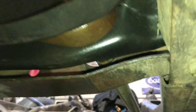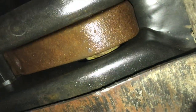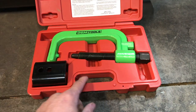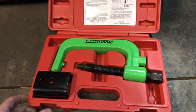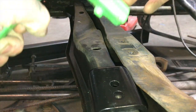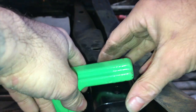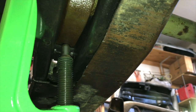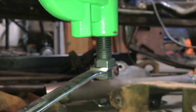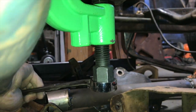In order to remove these torsion bars, you first have to remove the torsion bar keys, and to do that you need a torsion bar unloading tool. I rented this one from my local AutoZone — they have a free tool rental program. You'll set the bar on top of the cross member, and the C-clamp part has a little nipple that goes into the holes on the bar. On the bottom side, the screw goes up into the dimple on the torsion bar key. It doesn't take much force — I just used a one-inch wrench, though you can use an impact if you want.